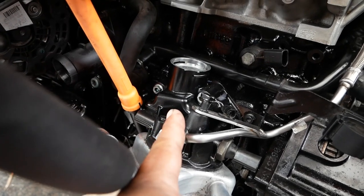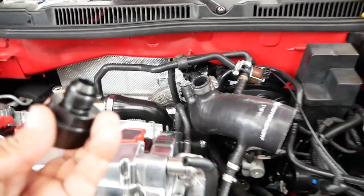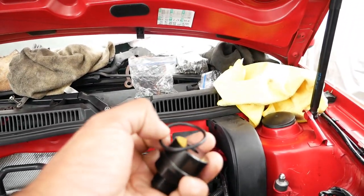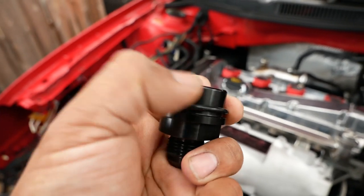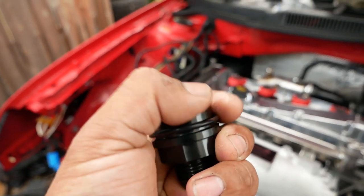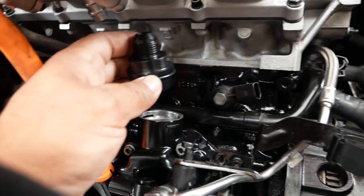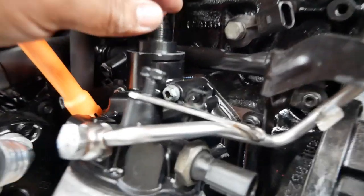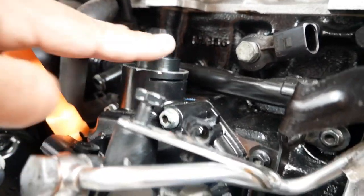What's super important is — actually, I'm sorry, that's wrong — the O-ring goes on first, right here on the billet piece. No lubrication required. Then we're going to push it down past the port opening. You can see the O-ring right there — it's got to go all the way down until the top portion is flush underneath the retaining ledge, so the clip can go in and retain the piece.